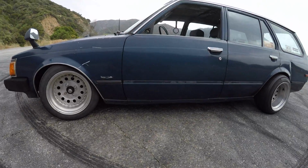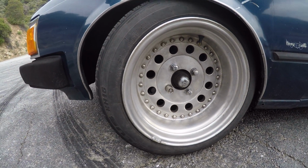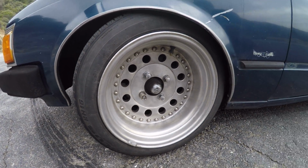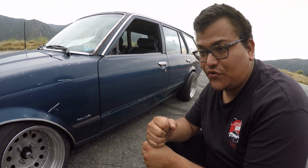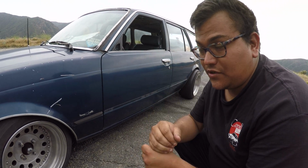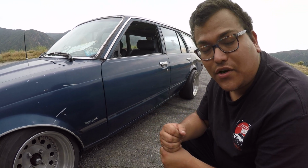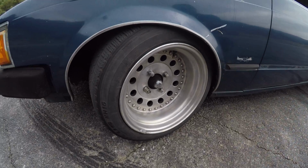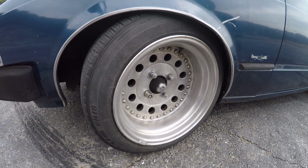He used a stock strut and spindle, cut 1 inch, and he put T3 sleeves and springs. And he also put in the MR2, kind of like what you did with the 88 MR2 front struts, and he put T3 top hats and universal camber plates up on top.